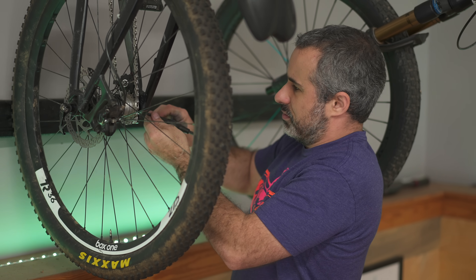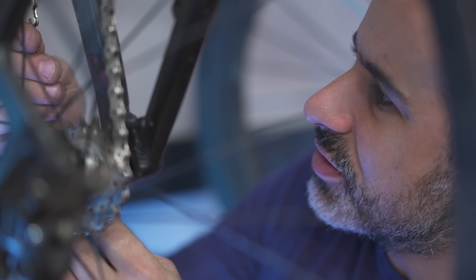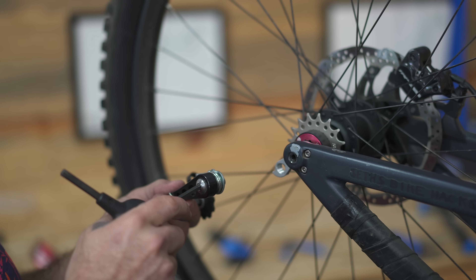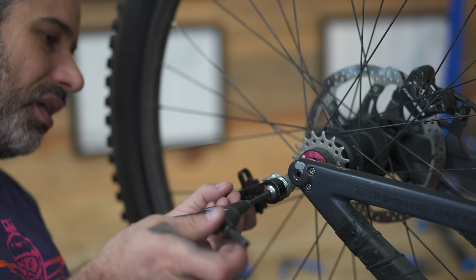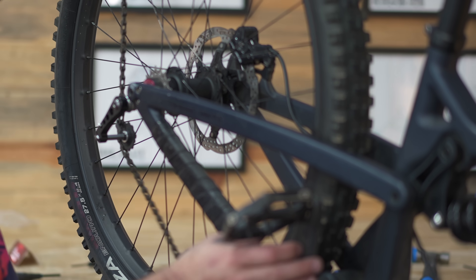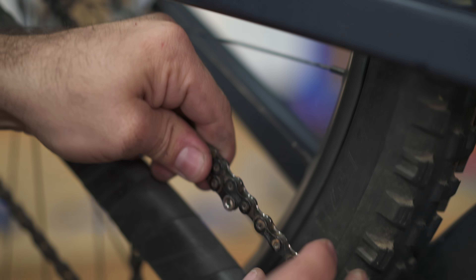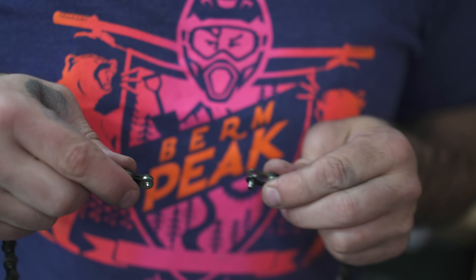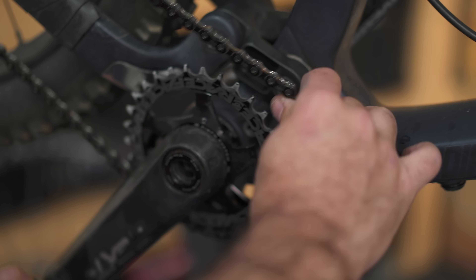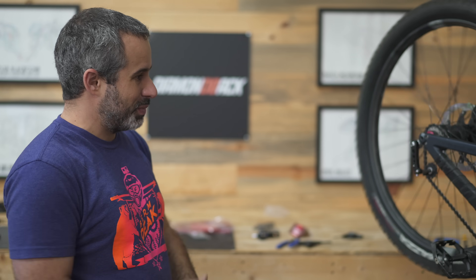We'll order a new one off Amazon and everything will be okay. I totally massacred the chain — there it goes. Where did my master link go? Honestly, you'd probably want a better chain tensioner than this one as well, but this is going to keep the chain tight because it's spring loaded. So we're going to route the chain through here, up and around, and just choose a length. I'm thinking we'll let this get nice and tight — that'll give us a little bit of space for chain growth. Now you can just gingerly sneak it on there. That keeps the chain nice and tight.